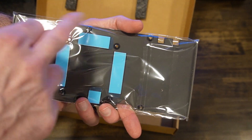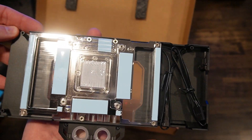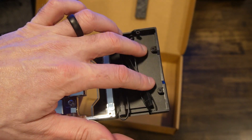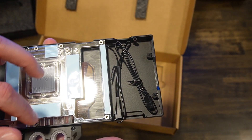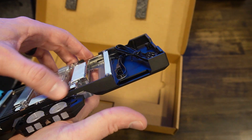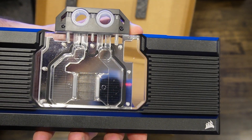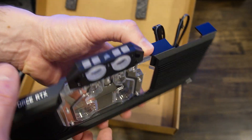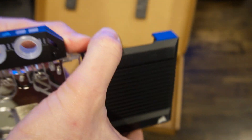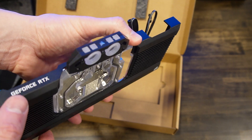I looked it over pretty well and I think the best bet is to use blue painter's tape — I'm going to tape up all the pieces I don't want painted white. I'm probably going to put the caps on the side since the tubes come out that way. We'll cap the tops off, and it would be fine to paint over the caps since they're black and we want those white too. What's going to be difficult is getting inside the LED spots — I'm going to try to tape in there so the LEDs still shine through. My first thought is to use regular metal primer, see if that sticks, then a couple coats, and then some satin white finish. I'm not going to worry about a clear coat — it's going in a computer, it won't get banged around. As long as the primer sticks well, we're good. If not, we'll wet sand with 1200 grit and use an etching primer.